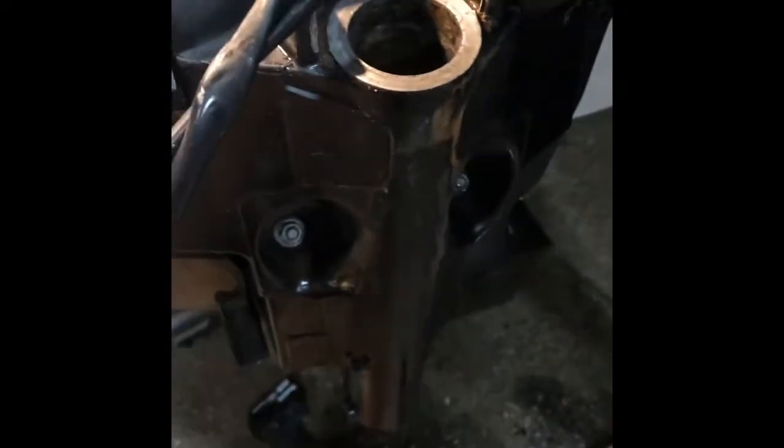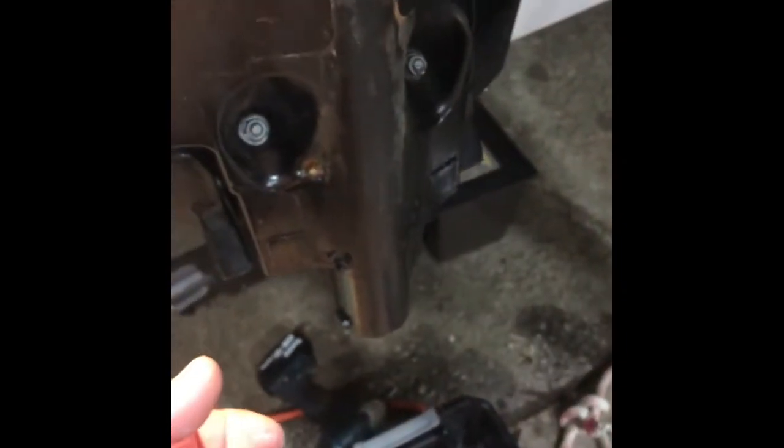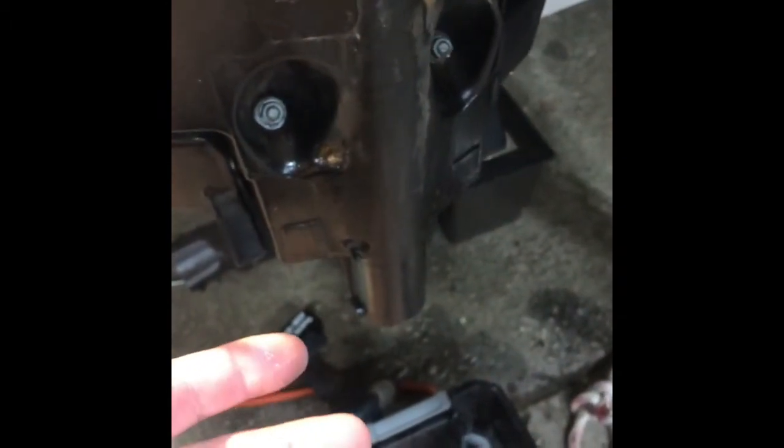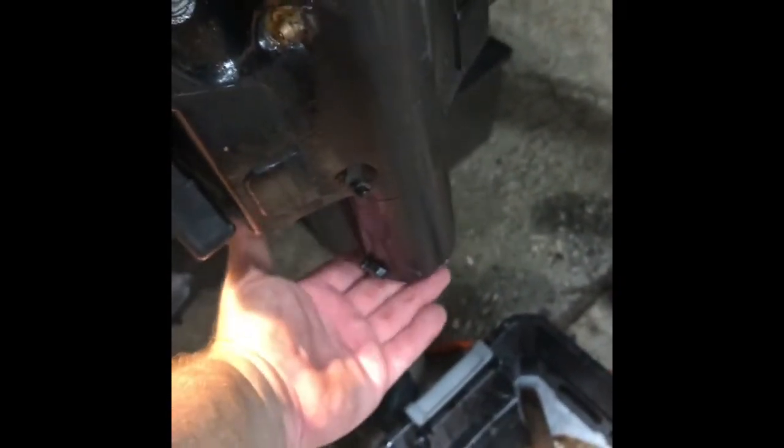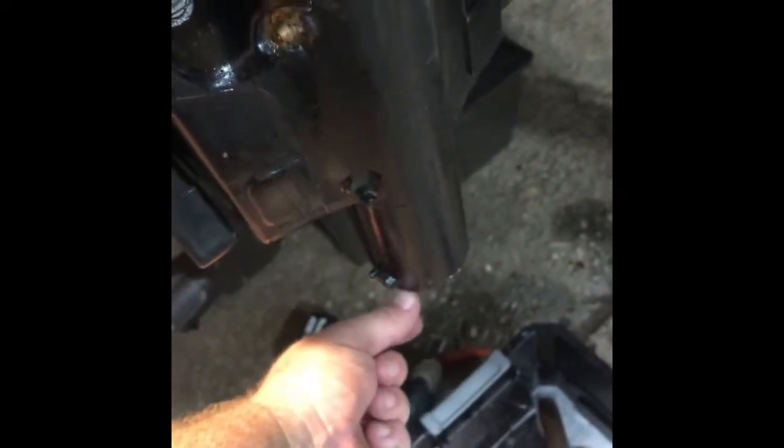And I went on Brown's Point. Yeah, see, you can see here's this big rubber block and those long bolts go through here. But I went on Brown's Point Marine, ordered, there's a plastic bushing that goes in the top and the bottom, and then there's a washer and some shims that look just like the washer, but they're smaller, they're thinner. I mean, they're the same size diameter, but thinner. They go on so the washer, the oil seal goes in after the bushing, then the washer, and then 4 shims. And then the spline deal goes back on, and that's pretty well it.